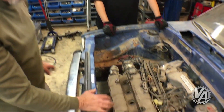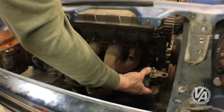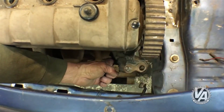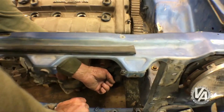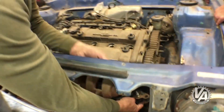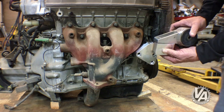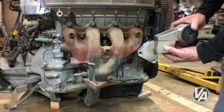The mounts are going to be fairly easy too. The way the mounts work on this car, there's a block bracket that bolts onto the front, and that's going to allow us to mount our mounts up here above the frame rail. There's no fender well in the way if we do that. I'll probably make a custom billet version so we can use our billet mount for the '84 to '87 with the B-series over on this side. That should be fairly quick to mock up and make.